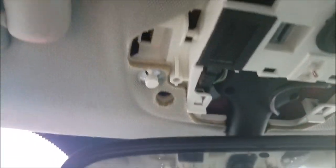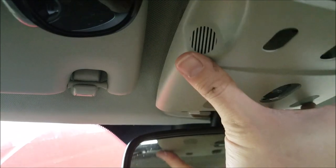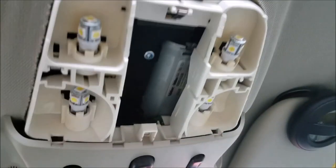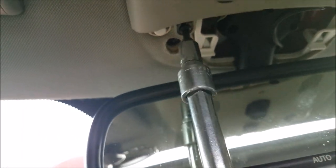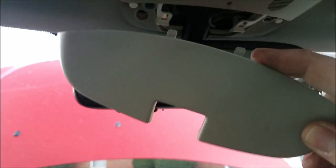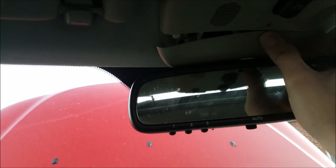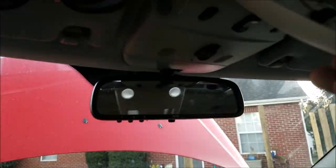Now it's just reverse order. Take the one panel that goes in the middle - it pops into place - and then install the two other torx bits. It's also a good point to mention that if you want to switch out any of these bulbs, now is a good time because you have this cover off. For me I just use a couple LED bulbs. Install and tighten the two T20 torx bit screws. Then install this little piece - notice the tabs at the end, put it into place, move it back, and lift up. It's held in with clips and pressure.